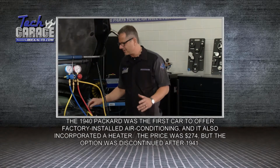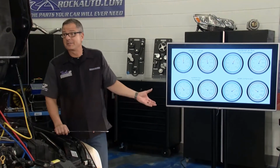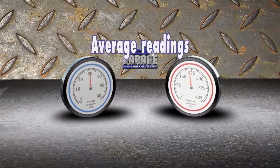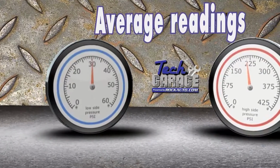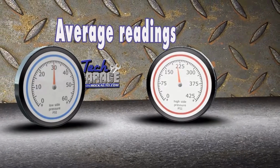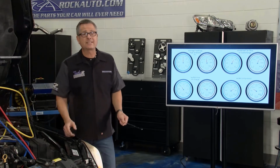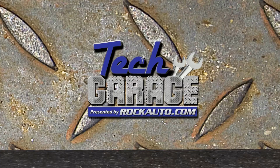Gauge readings are key. I have a couple of gauge readings right up here on the screen, Brian. Perfect. This is going to help anybody out, because it doesn't help looking at the gauges unless you know what you're looking at. Here we have the average readings. Systems today with refrigerant in there should be around 30 on the low side, up to about 175 to 225 on the high side. The compressor's pushing and pulling it into a vacuum, so everything's good there. Ambient temperature will also affect gauge readings. If it's cold outside they may be a little lower, and if it's hot outside, a little bit higher.